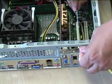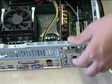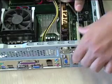Place the Firewire card into the hole that you have just created by removing the blanking plate. Use your thumbs to push down the Firewire card from either side until you hear that noise.